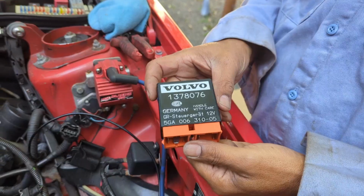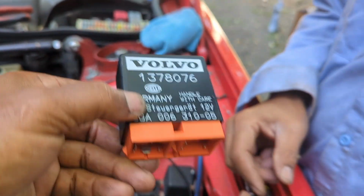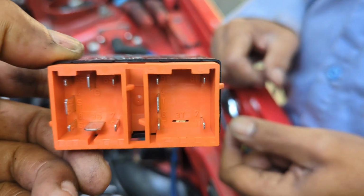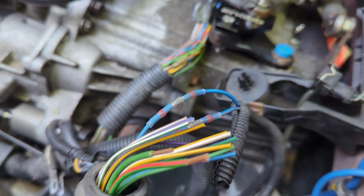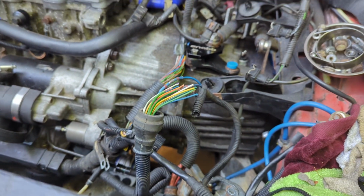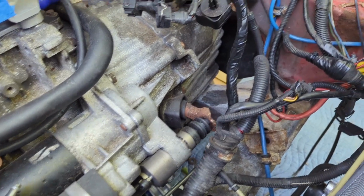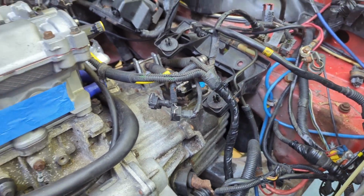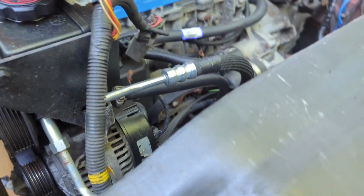Let's get started. Take this relay out of the fuse panel, 101, 102. This is a cruise control relay. Break off that pin, 3T. Now we got the reverse lights wired in, getting ready to wire in the starter circuit, and then we can keep on trucking. Have the wire harness taped up real good. Got the computer box in. Next we're going to do the fan mod.